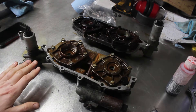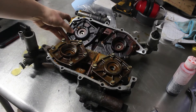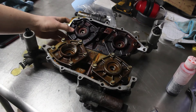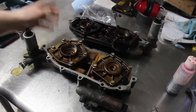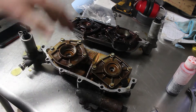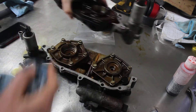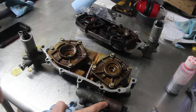This is my Vanos that came off of my original cylinder head. This is a Vanos I pulled with a junkyard cylinder head for no extra cost. I know this one doesn't make any bad noises, so I'm just going to put the seal kit in this, and then I'm going to take the solenoids from this one since they're pretty clean, and as you can see, mine are quite rusty.